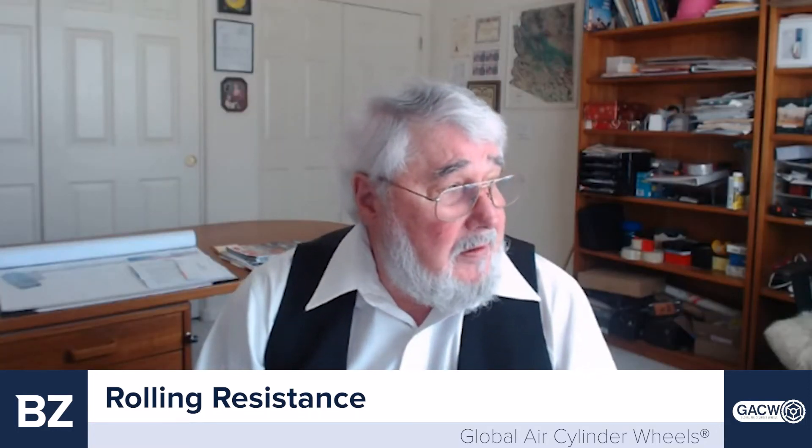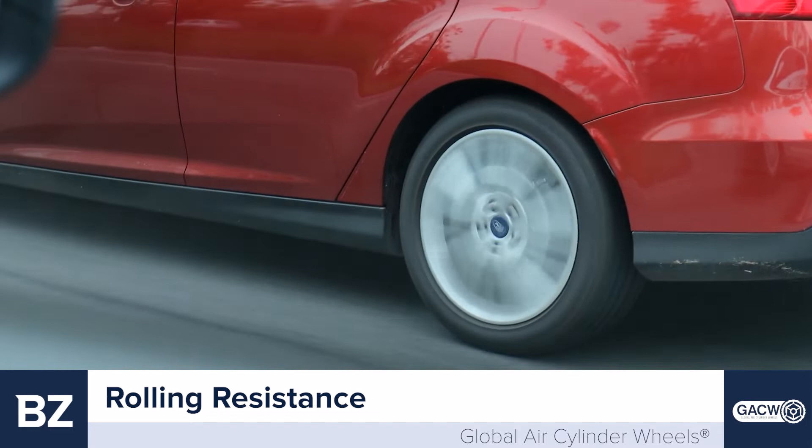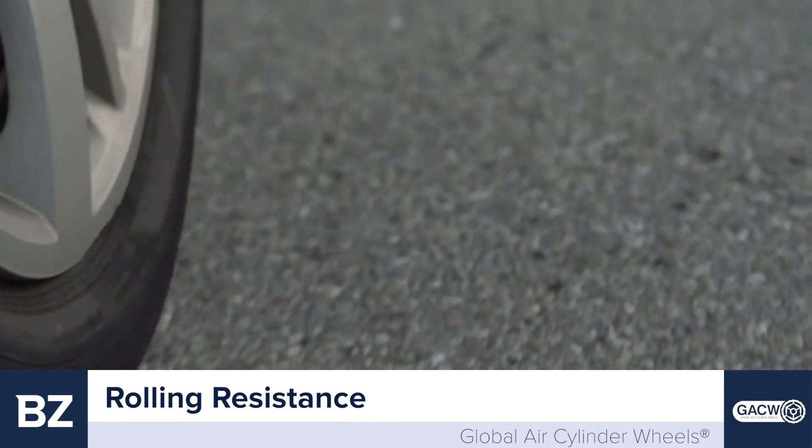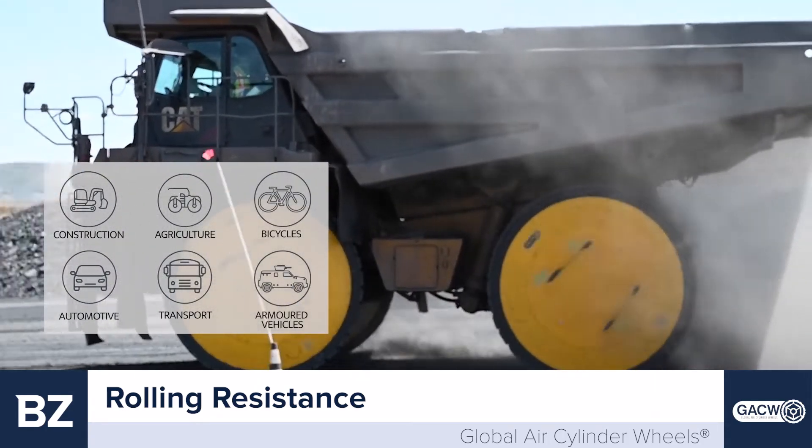Can you talk to us a little bit about rolling resistance? The rolling resistance is similar to sliding resistance — you pull a block on a concrete surface and it has a resistance, you need a force to pull it. The same thing if you pull an axle of a wheel, it's much less than sliding resistance, but still resists the wheel because there is friction inside the wheel. Also, the rubber compresses, and that provides another source of rolling resistance. In this mechanical wheel, the hub can be outside of the contact patch — ahead of it — which creates a negative rolling resistance effect, essentially rolling assistance. No other wheels can do this.